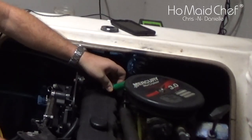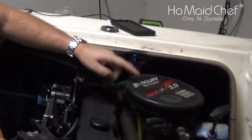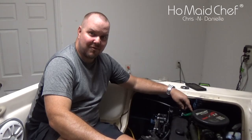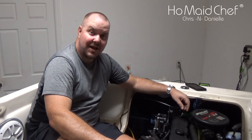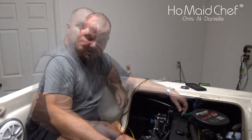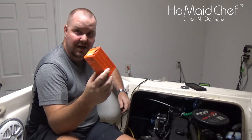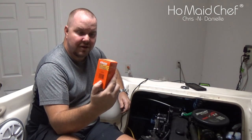We crafted a tube to go from our breather to our intake off our PCV valve, because we didn't have one. We have rubber hose, so yeah it's kind of ghetto, but it works. We also noticed we didn't have a fuel filter on this engine, so we picked up a fuel filter and it will appear in-line right before the carburetor. The good thing is this thing is clear, so we'll be able to see if we're out of gas, because we don't have a gas gauge right now — if this is empty, we know we'll have to be paddling.